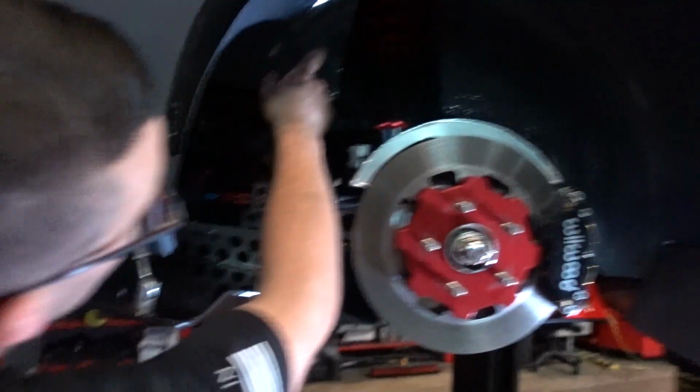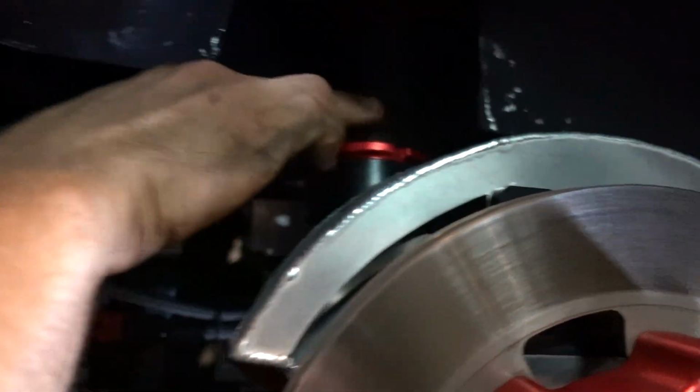Well, it looks like we got some trick components back there. Can we pop this off or take a wheel off and take a look? Absolutely. First off, you can really see how much meat this car has. 315s on a Datsun, 11-inch wide CCWs. It's the most tire I could fit. You can see it's close at full droop. Sometimes you barely tap the inside. It's worth having it. I actually had to modify the coilover tubes to even fit inside. The wheel comes inside this.